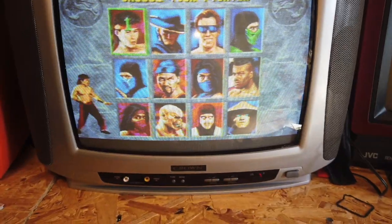Look at that — as you can see behind me, I've got Mortal Kombat 2 up and running. So it did just need a real good clean, whether it was the contacts or the board inside that needed cleaning. I'm going to take the case inside, clean it with some soapy water, dry it off, rebuild the cartridge, and have a look online for a new label. Pretty chuffed with that. Dirty contacts is everything I'm seeing at the moment — every piece of dodgy stuff I'm picking up from boot sales always has water or battery issues. They're fairly easy fixes, so don't be scared to buy something faulty on eBay or at a boot sale. Get it for a good price just in case it isn't a simple fix, but yeah, give it a go.